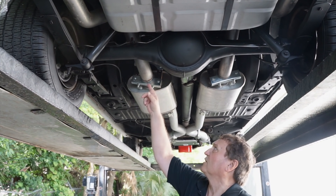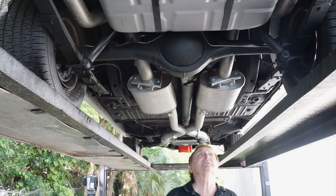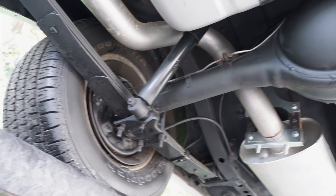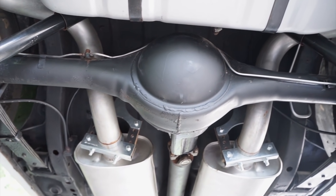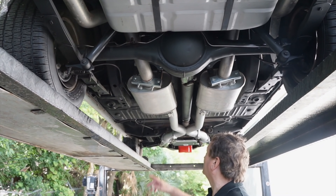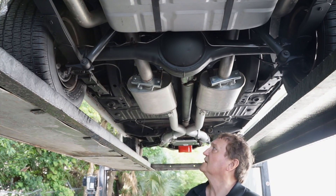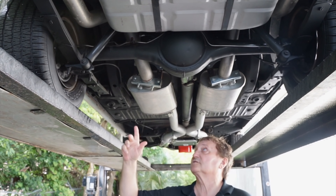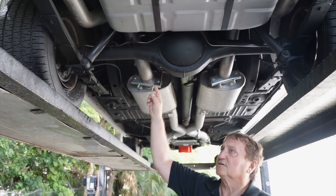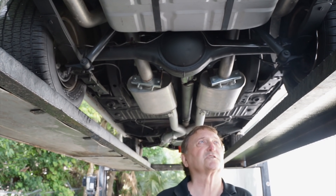All new brake hardware for the rear, with stainless brake lines coming back. Drum brakes in the back — heavy-duty drums. Four-piston calipers in the front. Three-inch diameter exhaust pipes the whole way — they somehow managed to fit three-inch pipes in this vehicle without them hitting, which I know for a fact because I drove this thing for a few days. It transitions out of the DynaMax muffler into three-inch tailpipes with correct-style stainless exhaust tips for 1968.